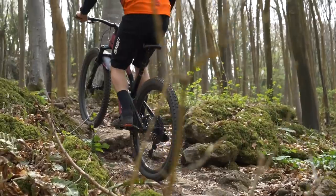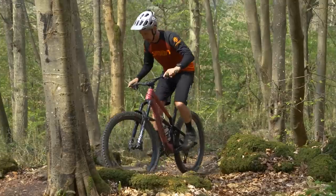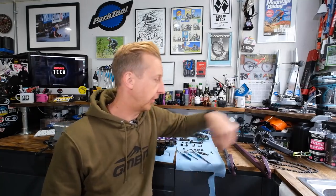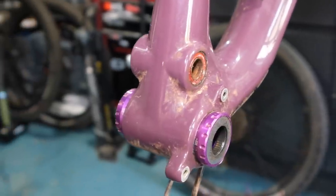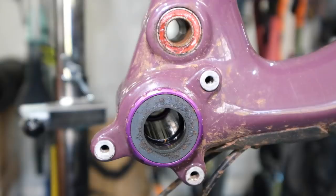When you're seated and pedaling, you'll have less power going through the transmission than if you're stood up. Let's assume the creak could be something to do with your cranks, pedals, or bottom bracket. I've actually taken the cranks off the bike — I've already inspected my bottom bracket, that's a new fitment so I know it's okay — but it's a good idea to take your cranks off and check the bottom bracket. Feel those bearings. If they're knackered you'll get movement there, and movement translates as creaking quite a lot of the time. Replace those bearings or if need be replace the bottom bracket.